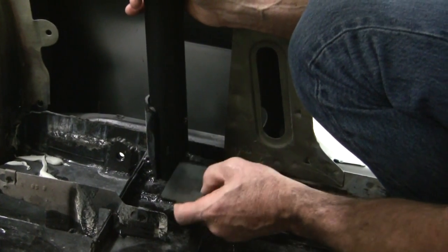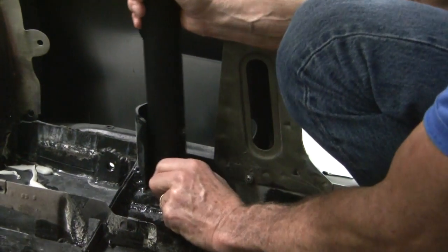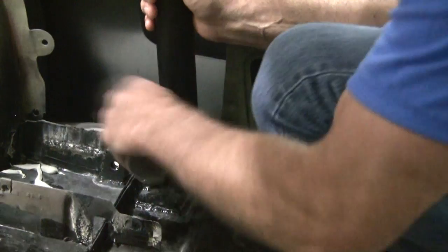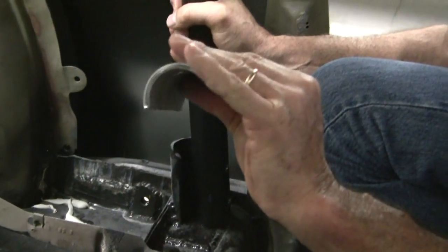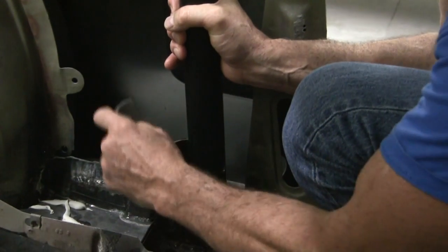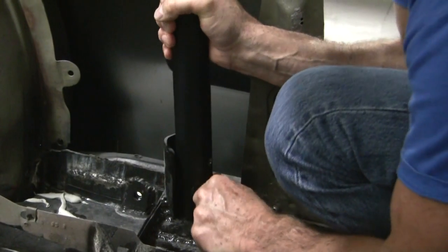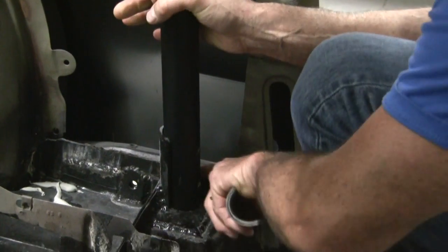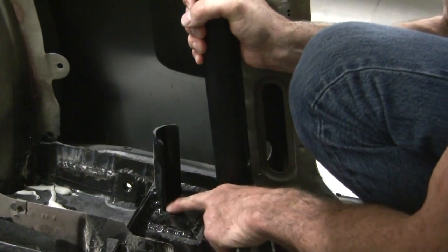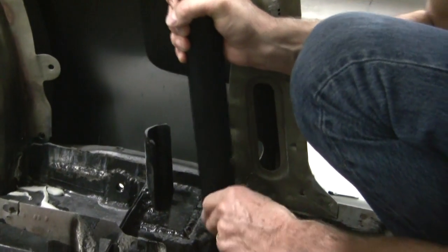Once you've got your plate welded on and you got it where you want it, then you're going to take this back piece and line it up exactly where you want. Now we've got a round radius on the top and a little square on the bottom. Square goes on the bottom, so all you'll do is put this plate right back there like we have this one, push your roll bar back where you want it, and then start to tack weld it. Then you can pull it out if you like and weld it on the inside or on the bottom. If you weld on the inside, make sure this is short enough.